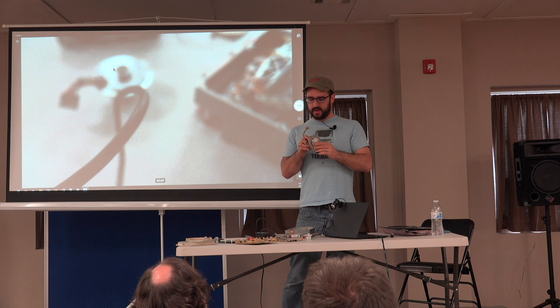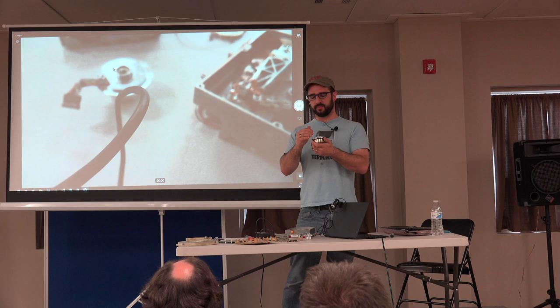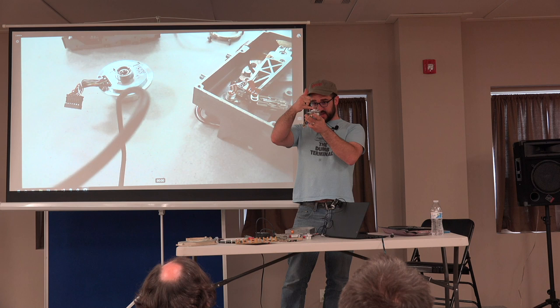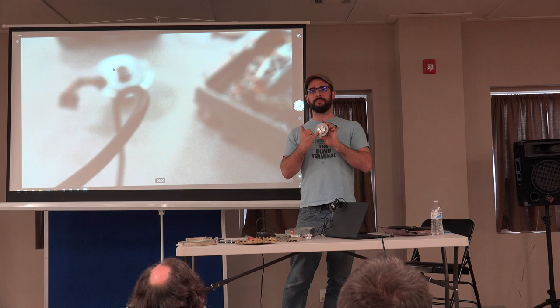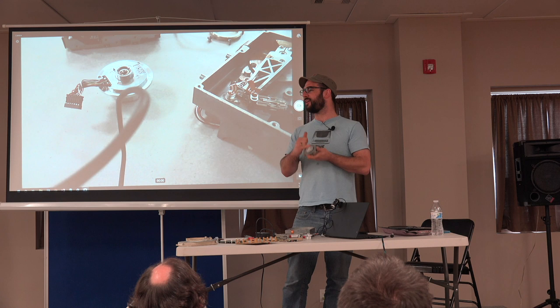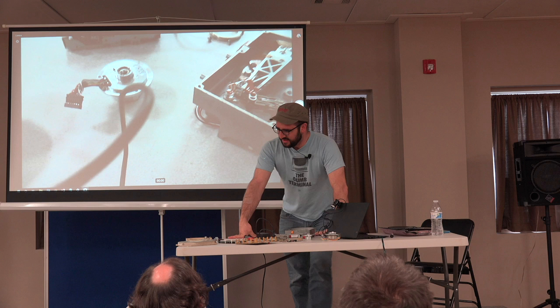Additionally, I was like, oh, maybe I can use a puller and get this top piece off, and then I can get at the bearing, maybe whatever else is in there. And then I took a flat edge, and the top of the shaft from the motor is slightly below the top of this mounting piece. So there's no way I could really reliably press this back together and get the disc height correct. It would be a little bit off, and then it would self-destruct the first time I turned it on. So I was hoping to have some better news for this presentation, but kind of dire.